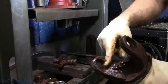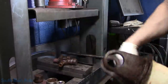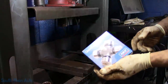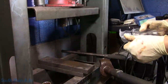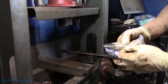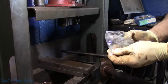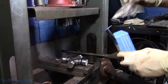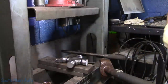Now we've got to go clean both yokes up, clean out the inside. Usually I'll wire brush them — sometimes you've got to touch them with a little cutoff wheel, especially if you've got a lot of rust buildup where the clip's going to sit. Then we'll just put it back together. Got them all cleaned up. Got some SKF U-joints from NAPA. I've used various U-joints on these — everything from OEMs to Moog, Precision, Spicer. They're all kind of expensive and I've never seen any really last past the 50,000-mile mark. These are greasable — I suppose if somebody did grease them perhaps they would last longer, but that's not going to happen.